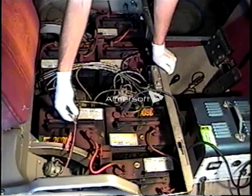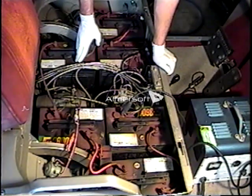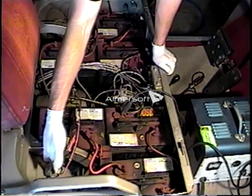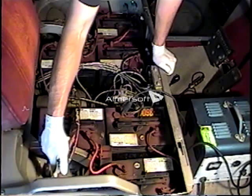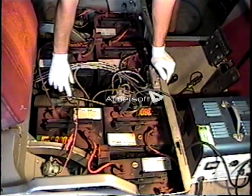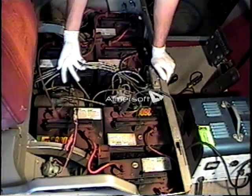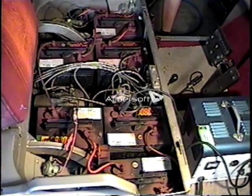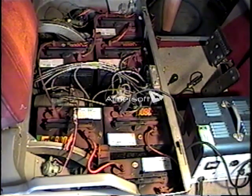One other part of the vehicle is the so-called overdrive. This is a dealer-installed item — some cars come from the factory with an overdrive, but very few. When this solenoid is activated, when current is made complete between the two low amp terminals, it closes the circuit between the two high amp terminals. Those two high amp terminals are connected to the field coil terminals on the motor. When this solenoid is activated, it short-circuits between those field coil terminals, which causes the motor to spin at a higher RPM. Having a high-speed solenoid or overdrive attached to a motor is hard on that motor and will cause the motor to prematurely fail.